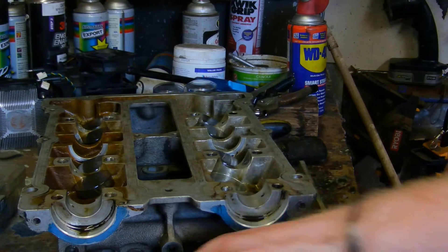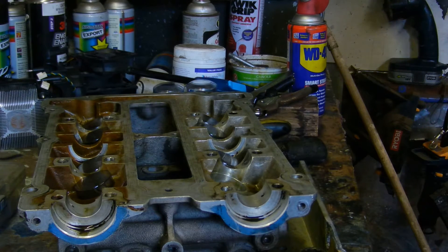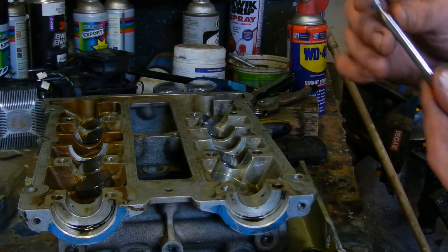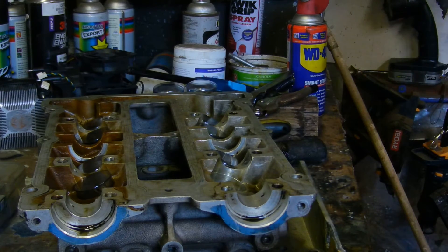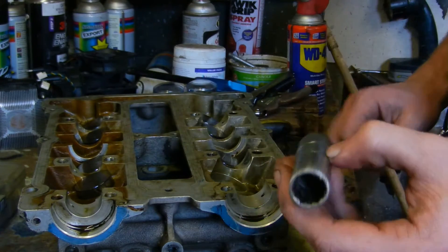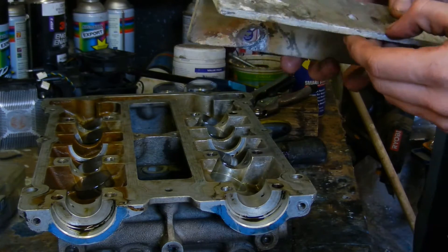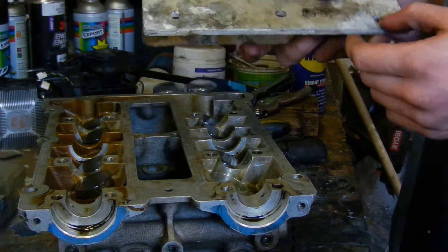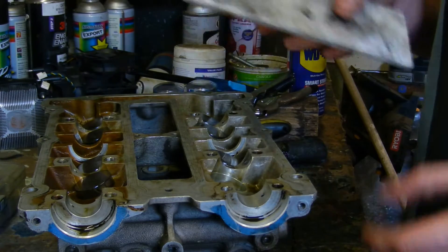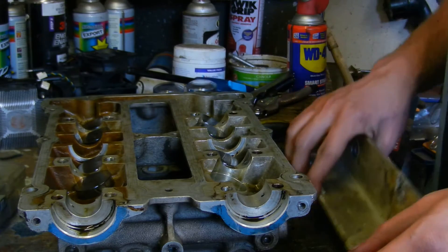So what you'll need — I'm just using workshop tools, not the valve removal tool that you can buy. You'll need a magnet, just an extending locating magnet. Any kind of long socket — I'm using the same socket I used to remove the spark plugs from this engine. And any kind of scrap, just a long bit of metal with a hole in the middle that the magnet can fit through. This happens to be an aluminium piece from my scrap heap, but any scrap metal will do.